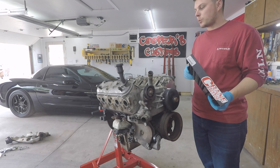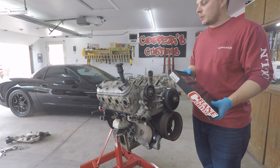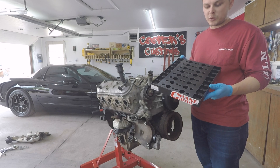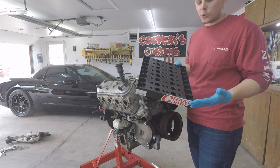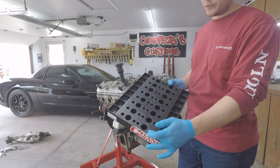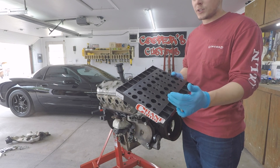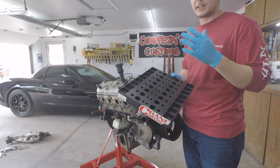We're making pretty good progress and we're about to start removing the heads and the valve covers first. But if you are going to be tearing the heads completely down, I would suggest getting this little tool — they're pretty cheap, I'll put a link in the description below. This is an engine parts organizer, so you can put all your rocker arms here, the push rods, and then you have room for both your valves. It has labeled front and back for each cylinder, one through eight, so that when you put it back together, everything goes in the exact same spot it came out.